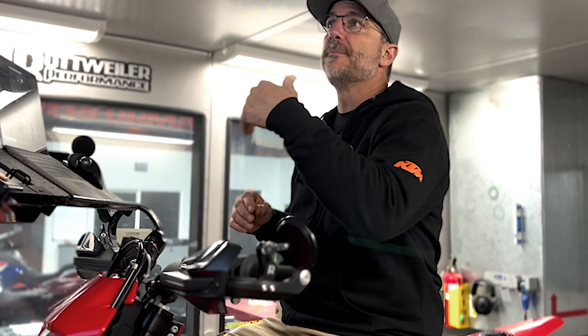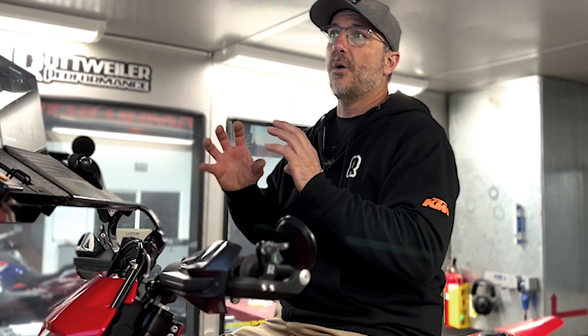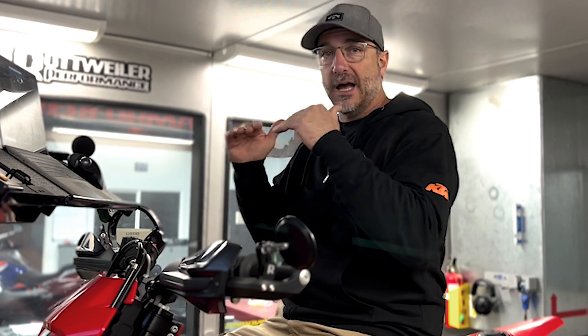It's the same engine, similar, but we don't know if on this Gasgas they've tweaked things a little bit. So we're going to start there. It's definitely going to be better than stock, and then we're going to make our tweaks from there. But in this section, what I want to show you is exactly what happens between the baseline and running this map. And then after this, in the next section, we're going to show you how we tweak that map to 13.2, and then furthermore, how we tweak that to the best power we can get.